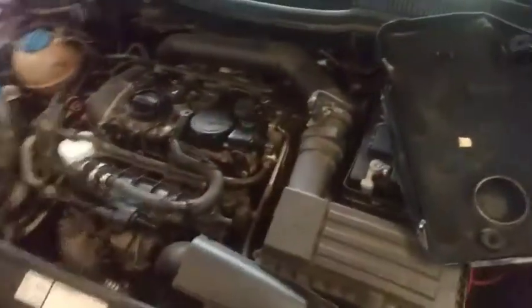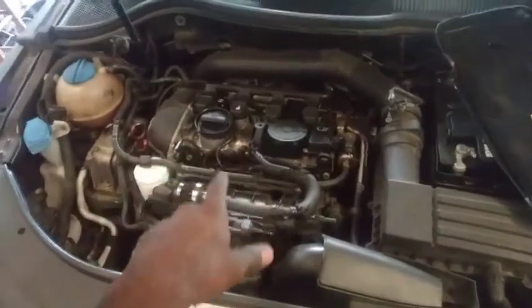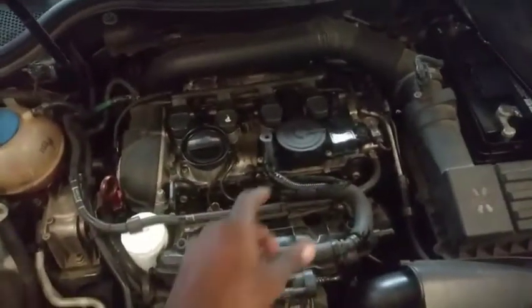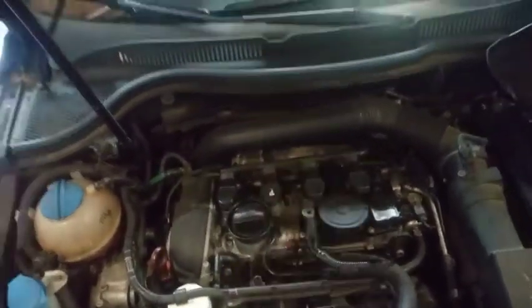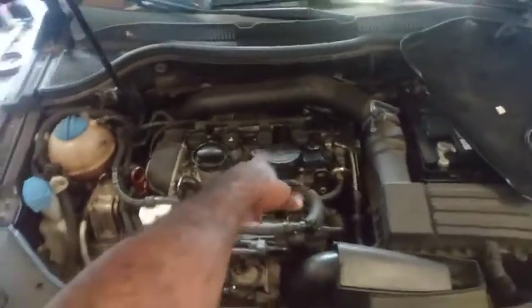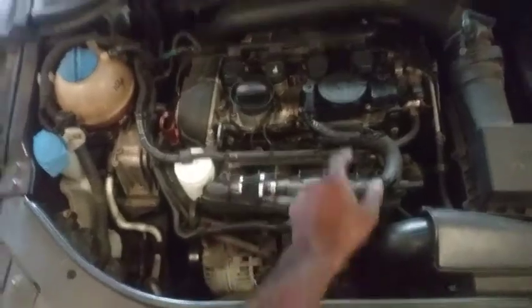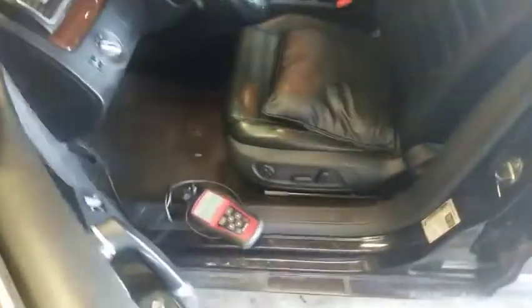The Volkswagen's back. This is the 2012 CC Sport. It's got a misfire going on with it, and it's always cylinder 3. I swapped these coils and had a question mark on that one, but that was on cylinder 3 - it was misfiring. We're going to look at the codes. It's got my basic stuff here and it's P0303.